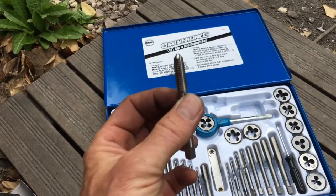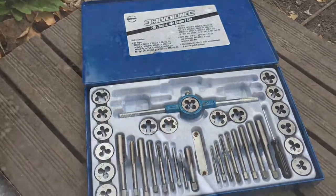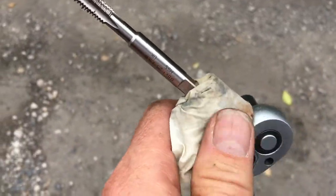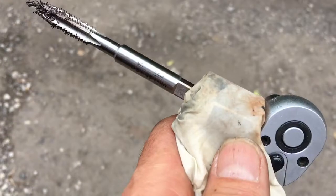As I say, this one came from Avon Tap and Die in Bristol. It costs £3. Using a really powerful neodymium magnet to stop the old pieces of thread falling into the hole and into the engine block. And a little trick is put an old rubber glove or some electrical tape or something around the magnet to stop the shavings actually sticking to the magnet, because it will be very difficult to ever get the job done.